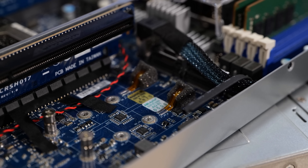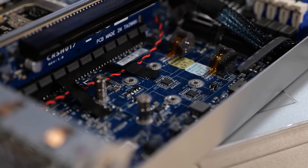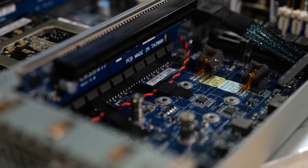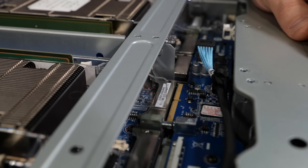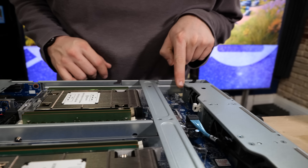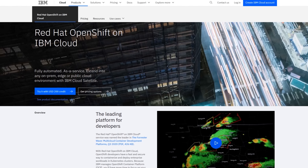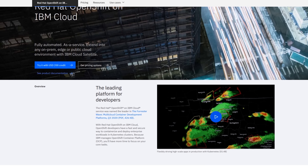You can also see that Gigabyte's got a little bit of special sauce. I'm sure if you're going to order a bunch of these — like a million-dollar order — talk to Gigabyte; you'd be surprised how willing they are to help you customize your configuration. This IO board back here doesn't necessarily connect to everything on the motherboard — that second U.2 connection, for example. But if you wanted to add a cellular backup interface for out-of-band management over cellular, you could do that with the headers available in this chassis. It really would not take very much engineering at all.